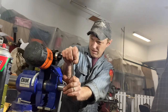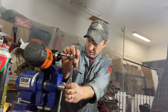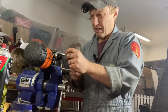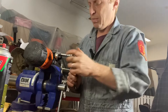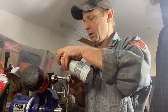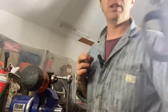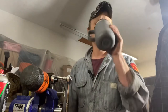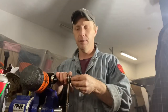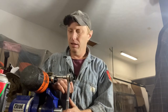Back to tighten it a little bit, then loosen. You don't just want to go ripping on these because odds are you'll completely destroy them. So I'm trying to be as gentle as I possibly can, a little bit at a time. Use whatever penetrating oil you want — I just happen to have Deep Creep on hand. Seafoam is generally some pretty good stuff, PB Blaster will work, Knock-er Loose, whatever brand. And this is some Rwanda blend coffee — really good. That way when you fail, at least you can fall back to great tasting coffee.